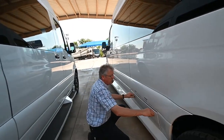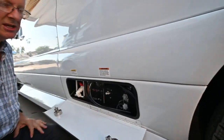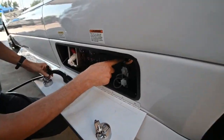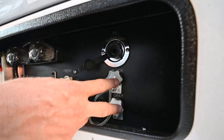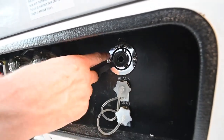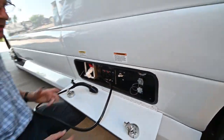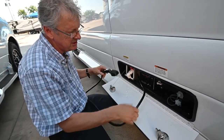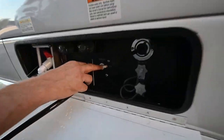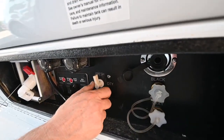One of the things you want to do when you first pull up to a campsite is hook up your city water. Your city water hose is going to connect right up here to this top connection - you don't want to hook it to the bottom one; those are flushes for the black and the gray. This is the city water connection. You want to use a pressure regulator back on the hose to regulate your pressure coming in so we don't have too much pressure on the lines throughout the coach. On city water you want to have this valve switched to city.